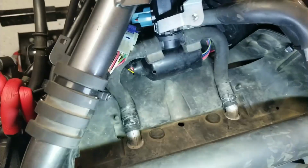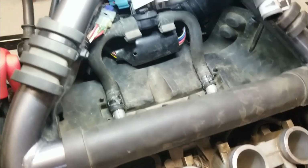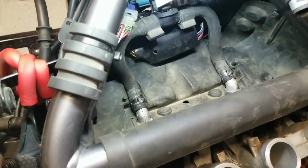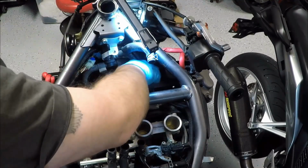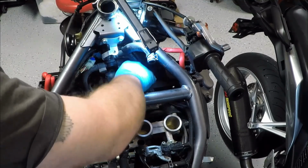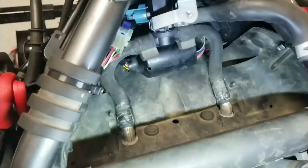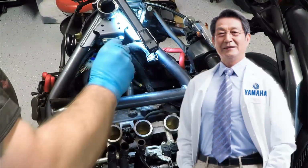with the exception of this rubber heat deflector that sits over the cylinder head. Now, if this were a bike I was going to keep, I would have left this rubber pad out, as it seems to restrict airflow to the airbox. It may prevent some heat from the engine and exhaust from getting into the airbox, but when you really need clean airflow at 3/4 plus throttle, this bit of kit I can't help but think would be restricting the flow. At least that's my opinion. And since we don't have a Yamaha engineer in my toolbox, that's what I'm sticking with.